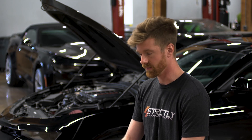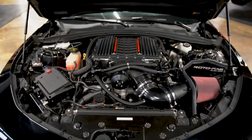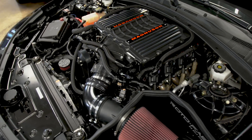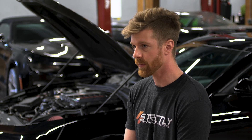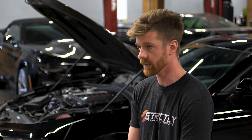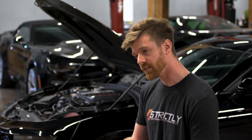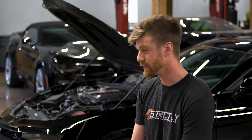To supply all the air to this engine, we have a 2650 supercharger from Magnuson. We also have a 112 millimeter throttle body from KTEC, a Rotofab Big Gulp intake, an ATI lower balancer with a 9.84 inch lower ring from DSX Tuning, and the standard Magnuson upper pulley, which is about a 4.3 inch — it's pretty big.